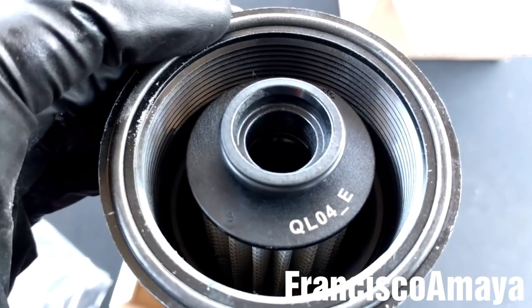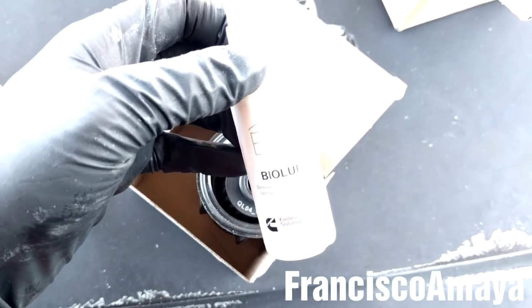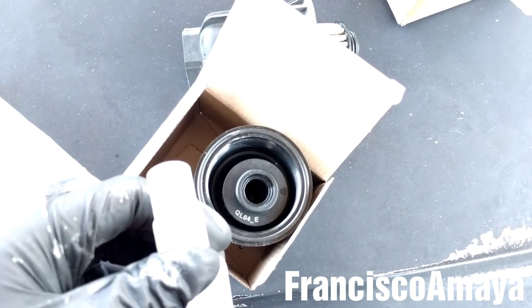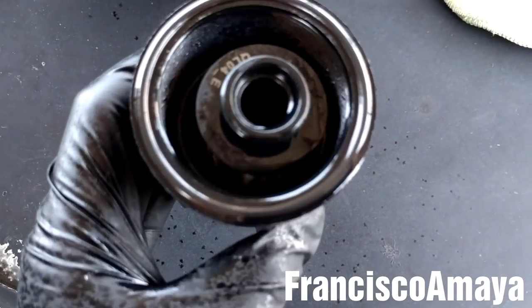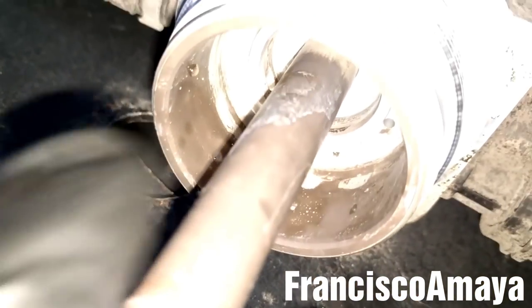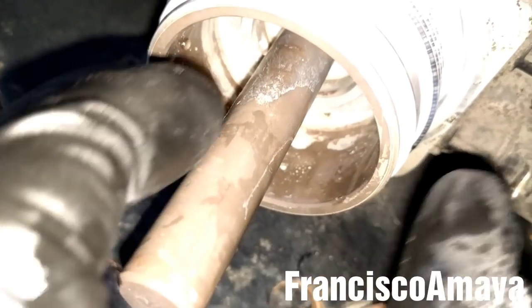The new o-ring is already on here. As you can see, this is the new seal for the filter housing. All you have to do is apply some of the lubricant that comes with the kit around and on the o-ring, so you can have an easy time installing the filter. After adding the lubricant around the seals, just check underneath for any component, any seal or anything stuck in this area. If there is any, clean the area very well before installing the filter.